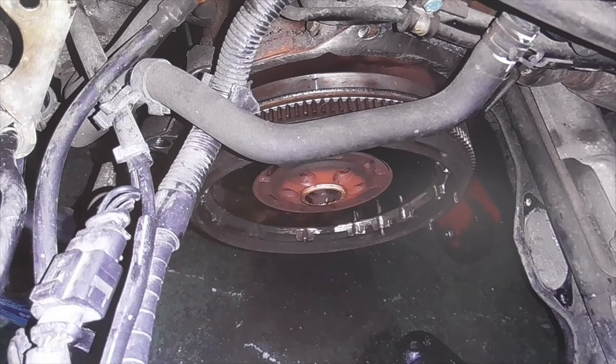For some cars it may be useful, but I would not put it on any car driven in a sporty manner, or on direct injection cars — especially turbo diesel TDI above 120 horsepower. I would not install it because in the end it not only affects the gearbox long-term, it will also end up causing problems — maybe cracks, even in the crankshaft itself — and over time the crankshaft itself could be damaged.